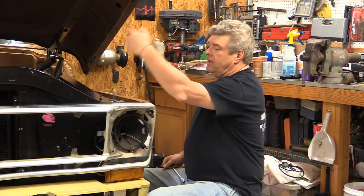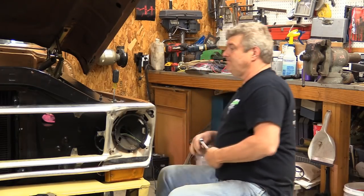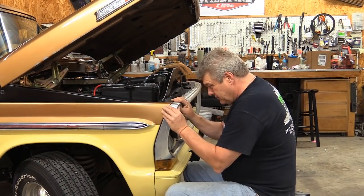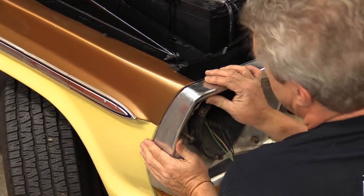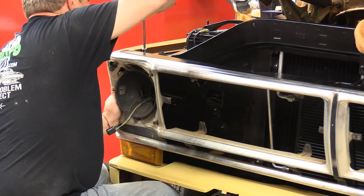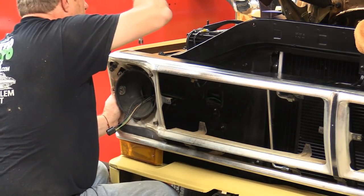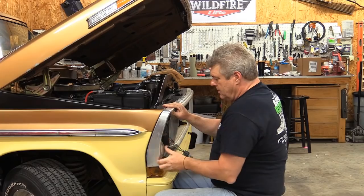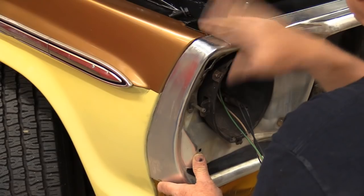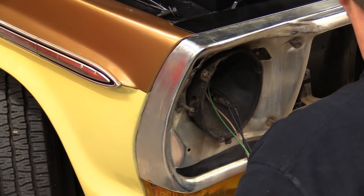I'm going to move to the other side of the truck where I've got a little bit more of a problem to deal with because it's not lining in like you'd want. Down at the other end, pulling this up and taking a look at it — it's flat and true, top and sides, a little funky right here on the corner, but I'm happy enough with it so I'm going to tighten all this stuff up. Position is good on the upper valence piece, so I'm going to tighten it down. This will all be final-set by the bolts that are inside of the fender — that'll be the next thing I do. I'm not going to fully tighten this because I've got a little bit of a surprise I want to talk about at the end of the video — something I'm planning on doing to this grill because it does need it.